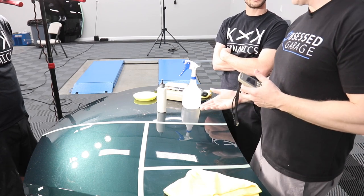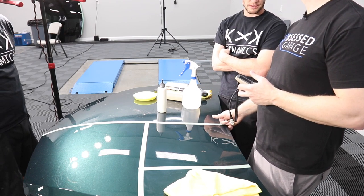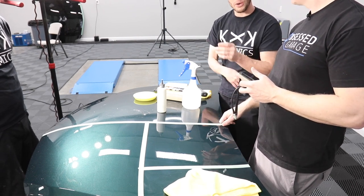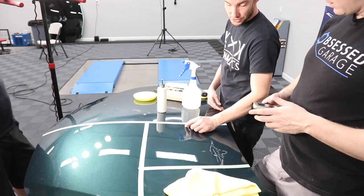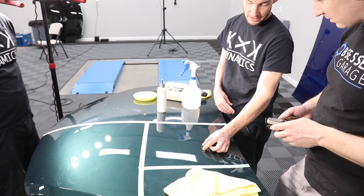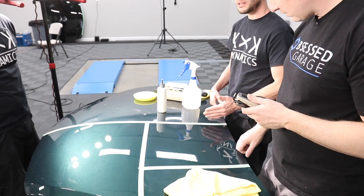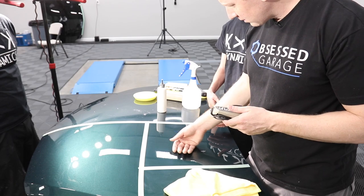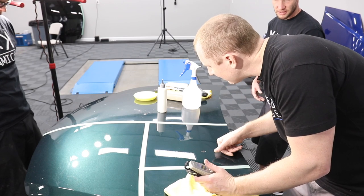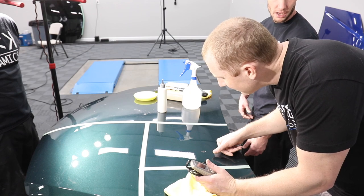And I don't think I would sand a car that started at 110. I wouldn't suggest it. If it was, say, 160, 170, then I could roll with it. It's a different story. Now, if I have an isolated scratch and I want to remove it, I would say that's okay. We're jeopardizing a little bit, but again, we have to look at, does this customer want to go to the body shop and fix it, or do we want to polish it and maybe save it, 6 months, a year down the road, if we get clear coat failure, which we might not?